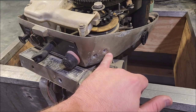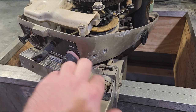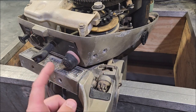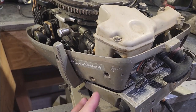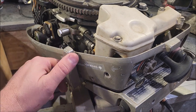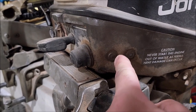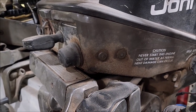On the side of these early motors we have these two little holes — that's where our bracket is going to attach. One of the odd things about this motor is these holes are already popped out, meaning it probably already had the throttle connector in here. But why is the stop switch still here? That I can't figure out. Maybe it was a remote control and somebody converted it over. These little fasteners are kind of like a plastic rivet — you pop out the center pin and then the outer pin comes out.